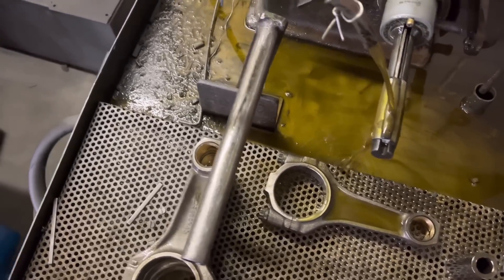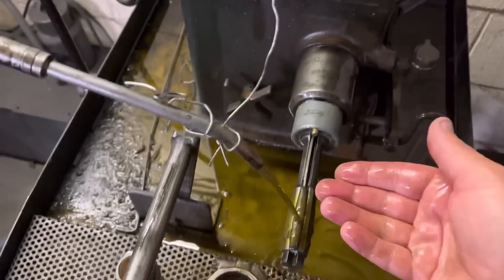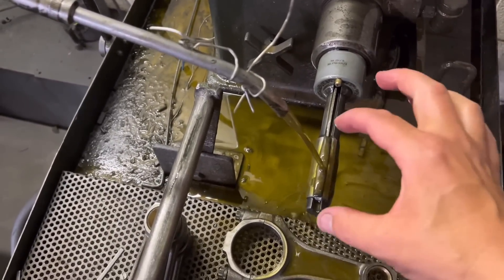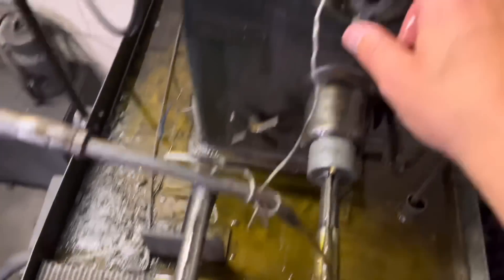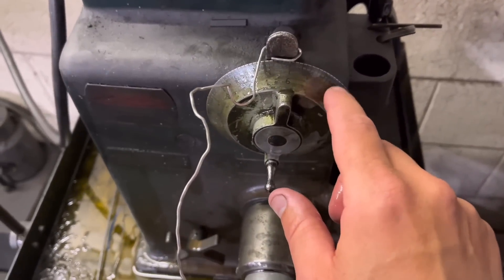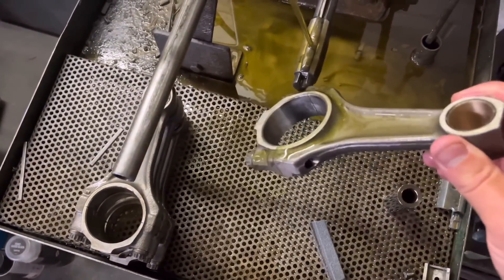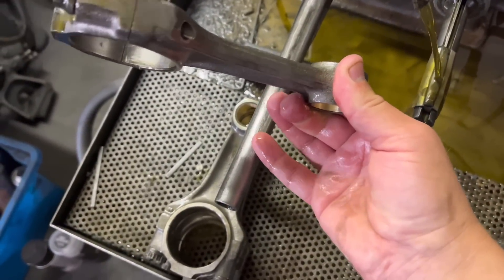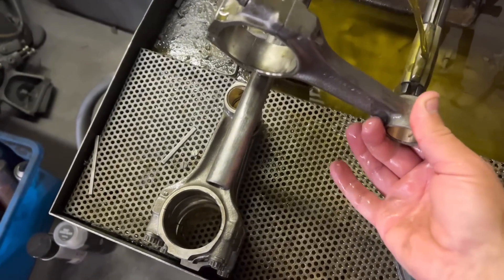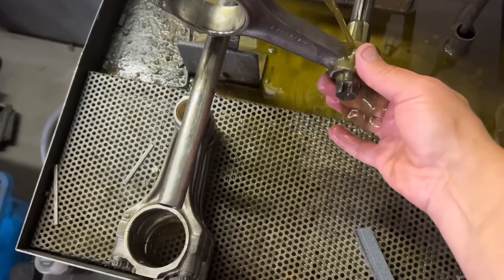It's got like a tapered feed here, and when you wind this gauge in, it pushes that bar out, which then pushes the stone out and puts a cut on it. I don't tend to take any notice of the digits on here - I might just do it by feel really. And so I'm halfway through doing this rod. You've got to stop here - this stops the rod from spinning around, so it's just a rest really. You've got to make sure that the coolant's on there - it's just a honing oil.